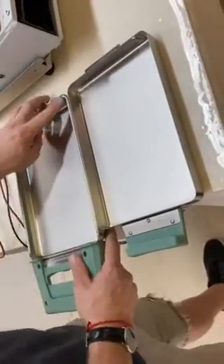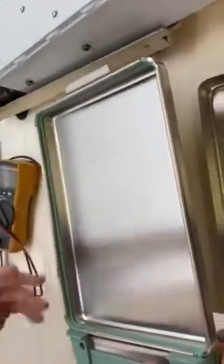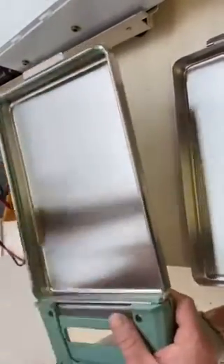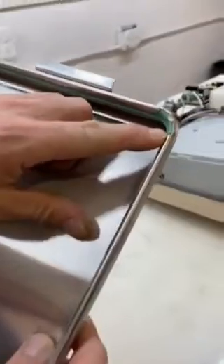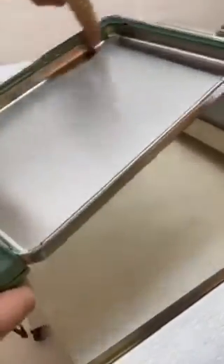If you still have the problem, we are going to address the cassette seal. If the cassette seal is not replaced every six months or 500 cycles, or not properly maintained with lubricant, it will fail prematurely. Double-check all the little rubber blocks — make sure they're all in the right place, front and back — then lubricate with some non-detergent soap.